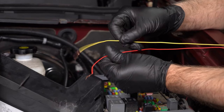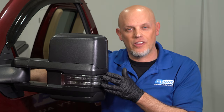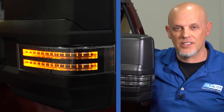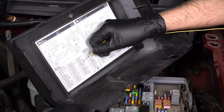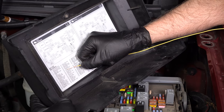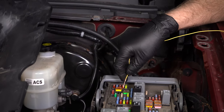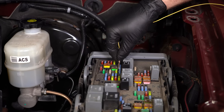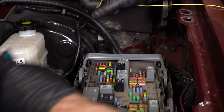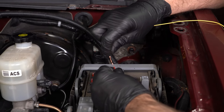Now we only have two left to figure out. Let's move on to the yellow wire. This yellow wire is going to be for the lights on the front of the mirror. We want those to come on when the parking lights are on or even the driving lights — so when you turn the switch on, those come on. Luckily, the same fuse box has a parking lamp fuse — left side and right side — it doesn't matter which one we go into. That's fuse number 26. When the parking lights get turned on, that fuse gets energized and we can tap right into there, using one of these piggyback connectors.